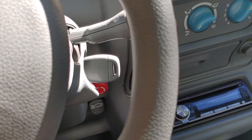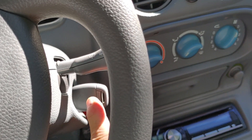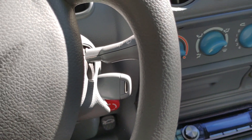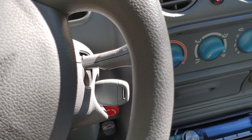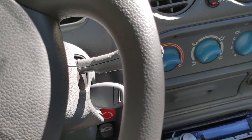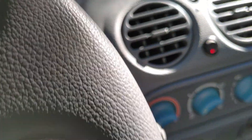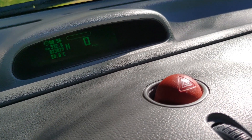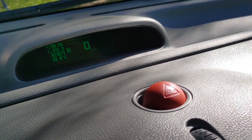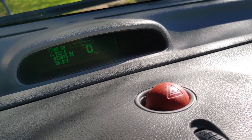So we're in the car now and I will take you on a short little drive with the all-electric Renault Twingo. We switch over to the back-side camera so you can see something there. Driving the car is pretty easy — it's like an automatic. We have the ignition key here which we use to turn the systems on. The startup sequence at the moment is still kind of manual as I need to fix all the cabling. There is no battery charge monitor at the moment because the BMS is not programmed yet with this display, so it shows the battery empty.